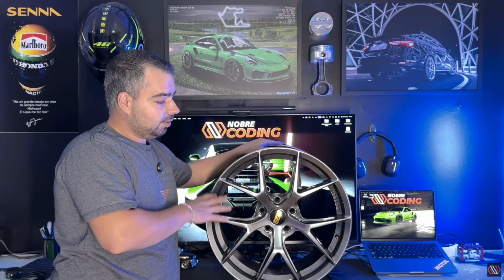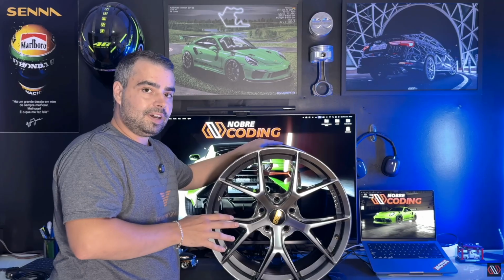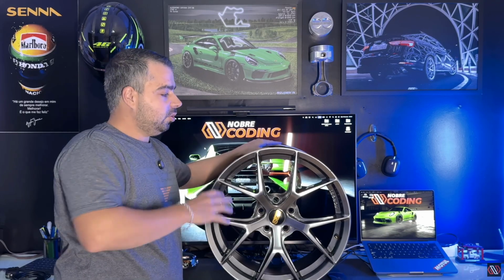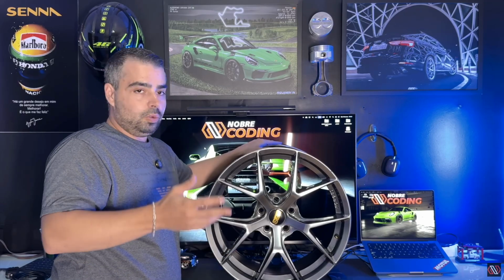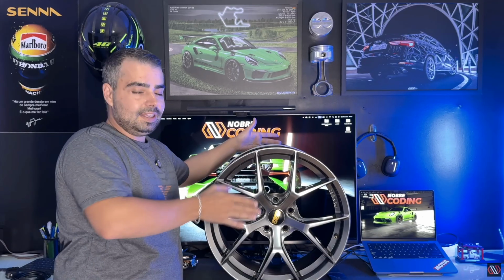You can use it on an Audi A3 like mine. Even an offset of 30 will still work, okay? But assuming that the wheel width remains at 8.5. I've used wheels with a 9.5 width on the Audi A3 with the offset 30. It sticks out too far and the wheel is much wider than this one.